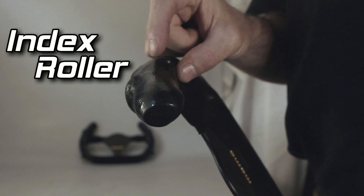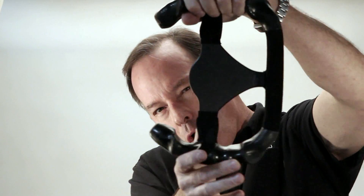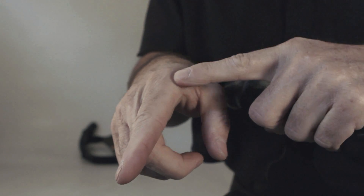The top wing in particular might not look fully featured, but indeed it has more features than the bottom wing. Let's talk about this little piece that appears to be missing — that is called an index roller. As you turn the steering wheel and your hand gets down low, the hand opens up and the index finger rolls against the outside circumference. Obviously if you had a wing material or piece of the wing there, you'd end up with nerve impingement problems and pressure points which could lead to blisters.